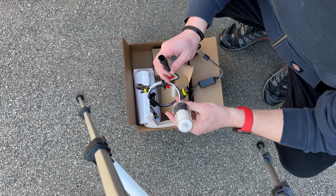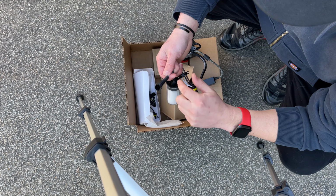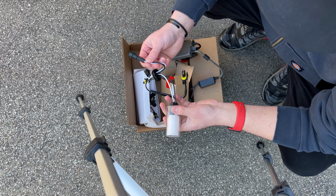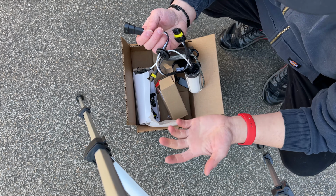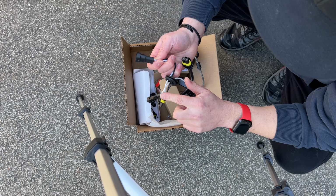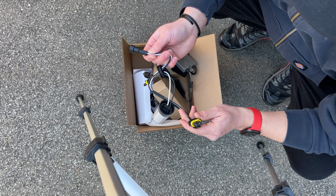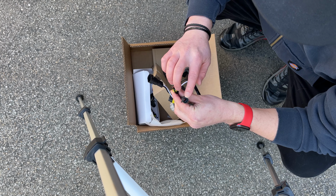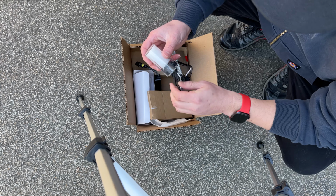This is the bulb side of the gasket. So in your car right now, you've got the wire that goes up and plugs directly into the bulb. But since we're dealing with HIDs and we've got all the rest of this excess electronics, you have to pass it out because there's no room. So this is from the car. It goes out down this wire, then this wire plugs into the input on the ballast side. Then it comes in here from this part. All this stuff just plugs right in just like that. And then it goes into the light.